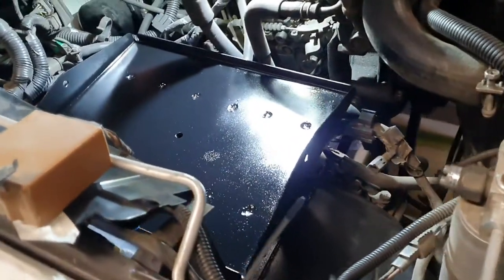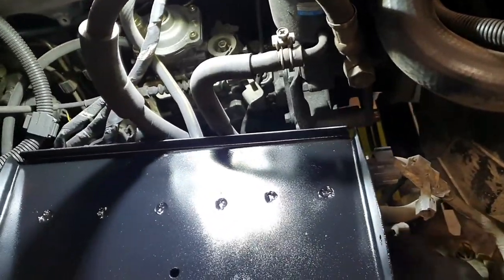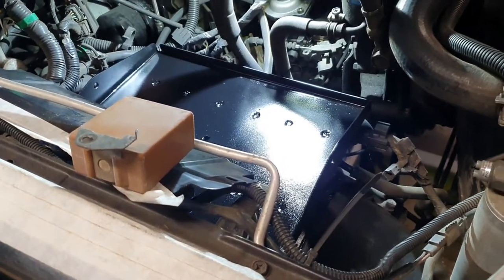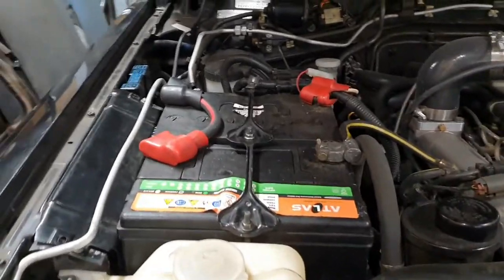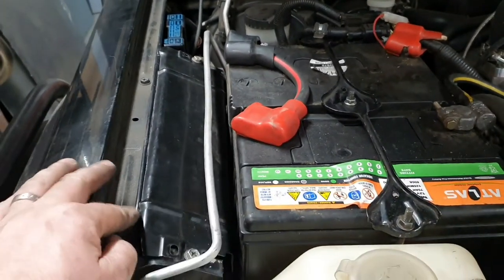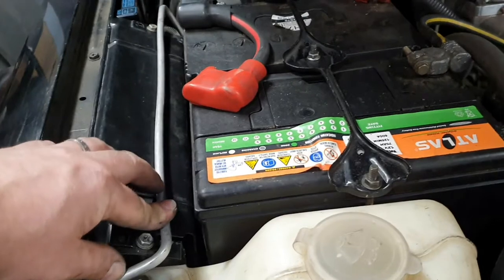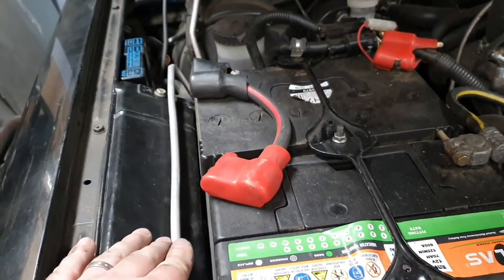It all fits. Aside from a couple of electrical connections — I'll make an earth cable up, might just buzz that straight onto the manifold or something. There's an earth here that goes from the engine to the chassis. Apart from those little bits and bobs, it'll be mobile again. Still some other work to do — busy tomorrow fixing the exhaust system. Had to make a bracket to relocate the fusible links, had to adjust this panel and shift the screw holes to move that and give clearance between the battery and the panel. It needs something to support this — probably just shift that down and put a P-clamp around that under that screw hole, and that'll be perfect.